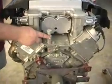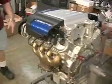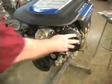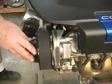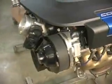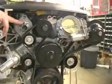Notice here's where we've got our oil pressure — we make the adapter to let you get to it. It's got quite a bit of room in the back of the motor, and basically it comes without any accessories. We're still waiting on the alternator and the compressor from GM. We ought to have it this next week. But this is the power steering pump here, and it has a spline shaft that bolts into it to take the force of the belts.